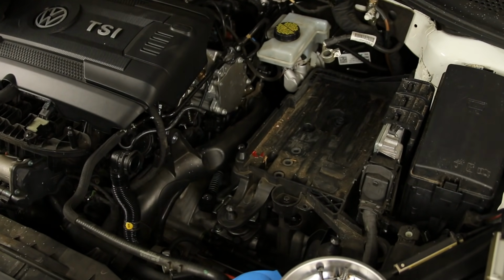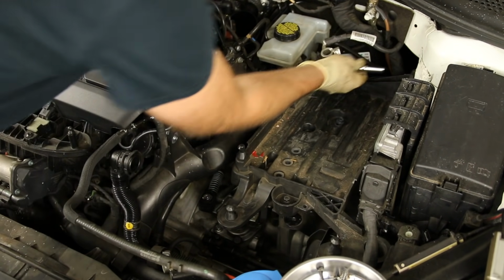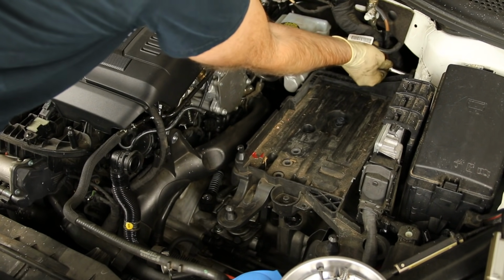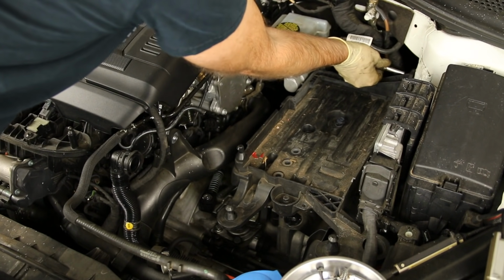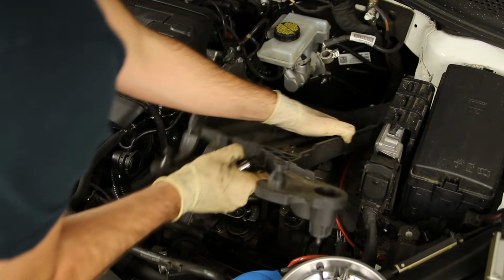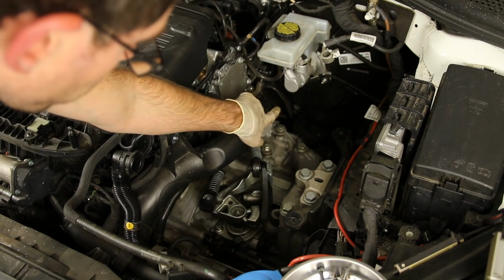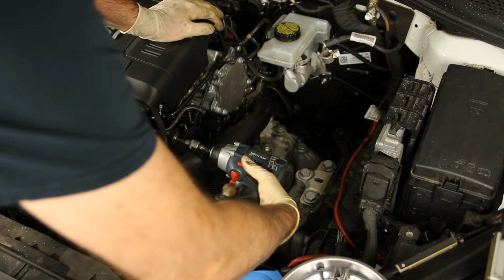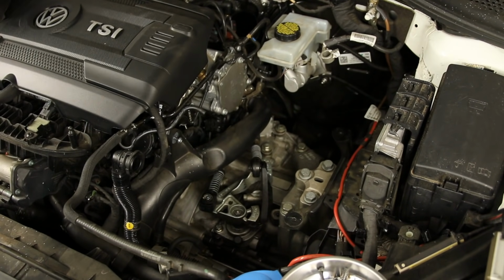And we're going to get this other tin out here. Just a little more play here. Now the last thing before we get in tight: your turbo muffler delete is over here, but this pipe will need to be loosened to give us the play we need. So we're just going to take a T30 and loosen that up, and it will just hang free there.